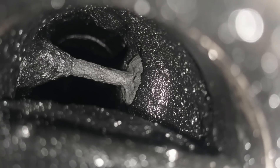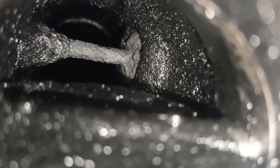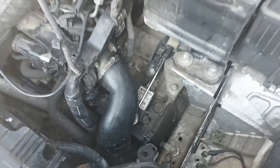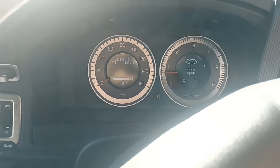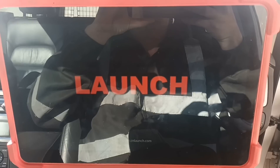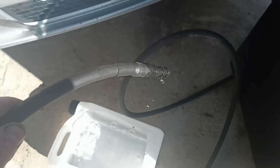Having a look inside at the EGR valve — that is what it looks like. That's the top end of the EGR, so if this carbon machine is going to work, we expect to see some sort of difference on that. You wouldn't expect it all completely shining brand new, but you'd expect to see some of it gone. We'll retest that afterwards. The car has done 205,000 miles. I've set up the Launch scan tool — this is a Launch Tab 3. Someone mentioned reading the cat temperatures before and after. The machine is powered up and we are producing hydrogen — let's get that directly into the engine.